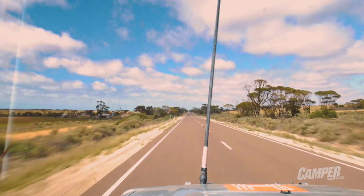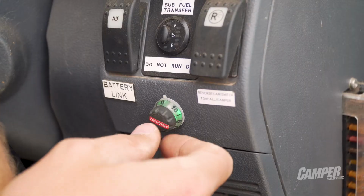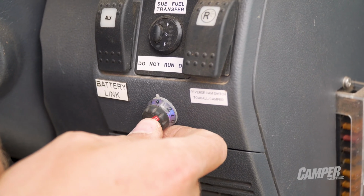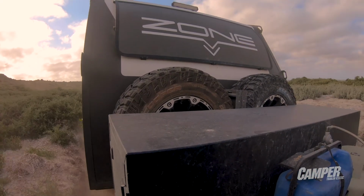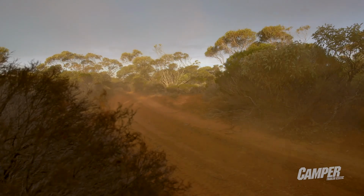But then there's also one additional feature that you can engage, which is total user control by pushing the button. If you push the button in on the controller module, it actually applies the brakes whether you're applying the vehicle brakes or not. And this can be important in a lot of ways. For example, if a trailer starts to sway aggressively on the road, you can actually tap that controller and stabilize the vehicle and the trailer.